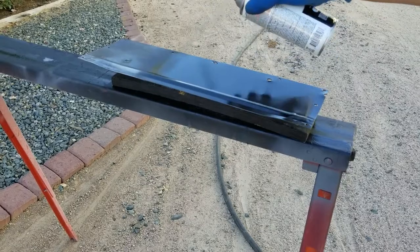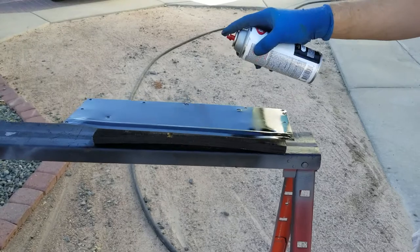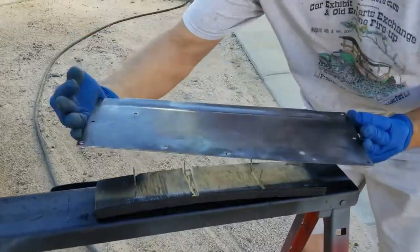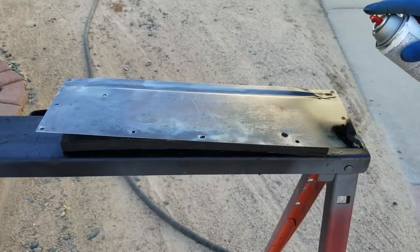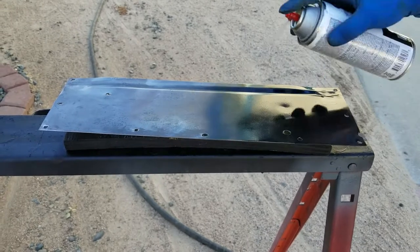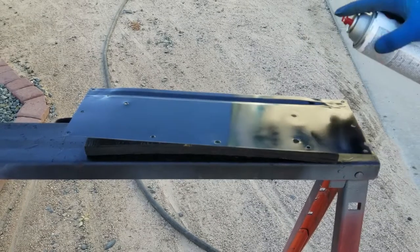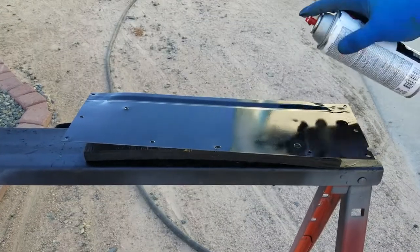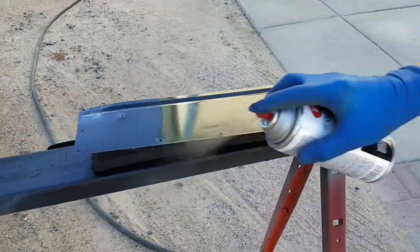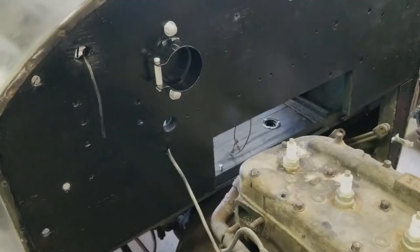Here I am painting a piece, showing Trish a trick that all of you could use. I am using a spray can, nothing wrong with that, on a piece that's totally stripped. But the thing that's really neat is it's sitting on six nails. If you notice that, you flip it right over while it's wet and you paint the other side. When you pick it up when it's dry, you'll never even notice that you painted it that way and had six nail points on the one side. It is a really neat trick to do something really fast that turns out beautiful. And you can notice how I spray paint. Use a spray paint can the way you're supposed to. The finish will look absolutely gorgeous.